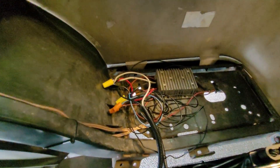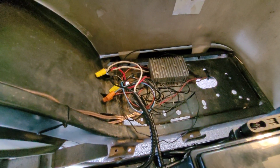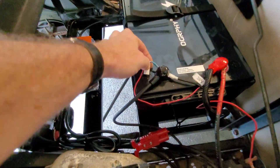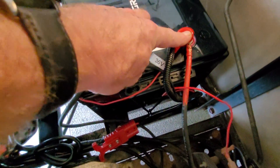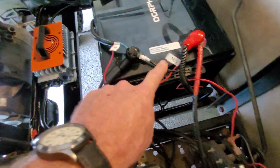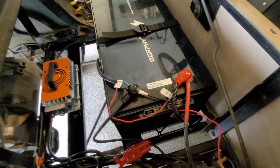There's also the 36-to-12-volt inverter converter — it's kind of a mess over here. The wires come right here: here's the blue for the negative side, here's the red for the positive side. Pretty much just three wires on each side — it's extremely easy to wire in.